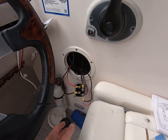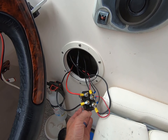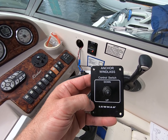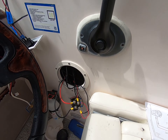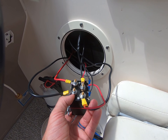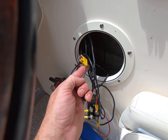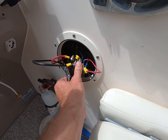I wired in this solenoid which was really pretty simple. It was all the same wires that came off of this unit right here. You just have to follow the wire diagram, which I'll try to include, and then wire to the switch an up, a down, and a positive. I also included an inline 3 amp fuse. Very simple — sounds probably 10 times more difficult than it actually was.